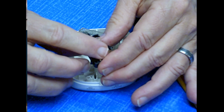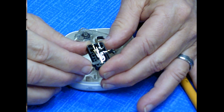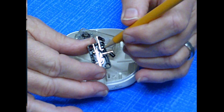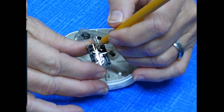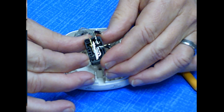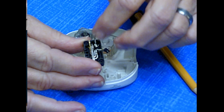So this mechanism has a couple springs in here to center this piece. One spring pushes it back, pushes this out. The other one responds by keeping it in line. There is a small gap right here. When this is charged, has a contact to the outlet, then when I push it this way, the electricity closes and I have a complete circuit through here.